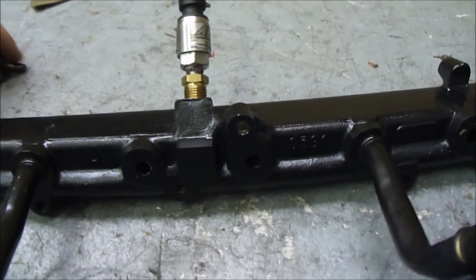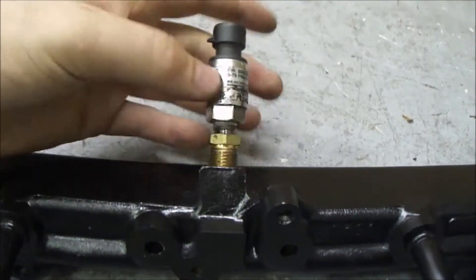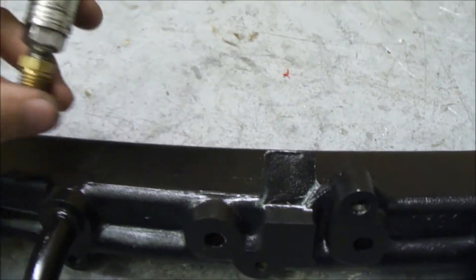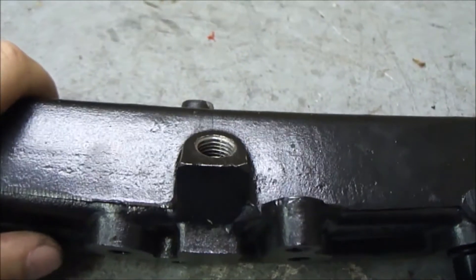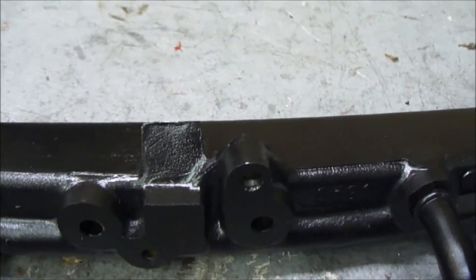It's quite a bit of things and it's still hard to find information, which is one of the reasons why I made this video — it was kind of difficult to find a lot of things. Also, we're running a MAP sensor, so we kind of came up with this here. This is originally kind of like a PCV, but we're running a catch can, so something like this should be okay. The MAP is a little bit more difficult to acquire when you have these throttle bodies, but we're hoping this way works. I've seen a couple other posts on forums saying to T this or T that, but I feel like this is one of the better ways to run a MAP sensor.